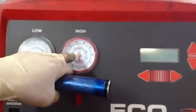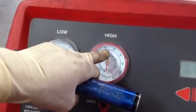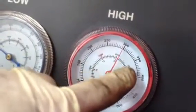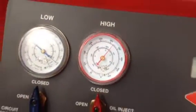If you're looking at these two gauges, this is the high side. This is the pressure that we're worried about — as you can see it's going up above 250, inching toward 300. What's happening is as this thing gets above 350 and closer to 400, it has a relief valve and it'll automatically discharge the AC pressure.